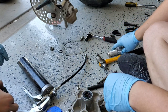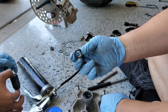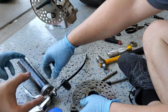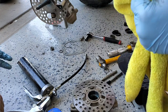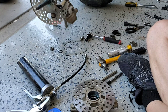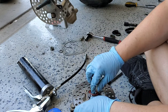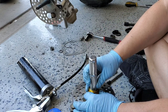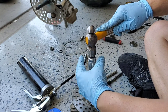My son cleans up the little inner race spacer and we flip the hub over since the outside is done. We drop in the bullet assembly first — don't forget that part. Then we take the larger bearing and drive it in with a bearing driver. You'll hear the sound change once it's all the way down — you can hear the difference when tapping in bearings.